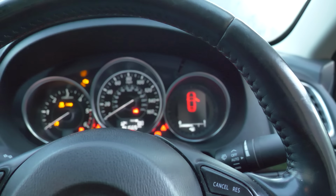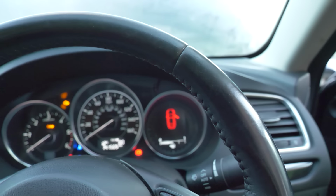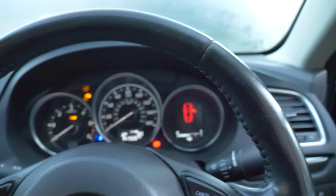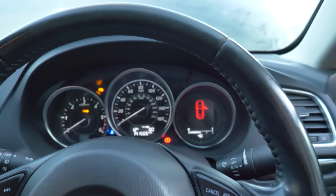And it was about here when I started to fear the worst and think about a seized engine that I should have checked way earlier on. Still just a click. So I don't think it was the starter that's broken, to be honest. The jump cable got really melted, really hot. So I'm a little bit worried, but the first thing I'm gonna rule out is if the engine is seized.